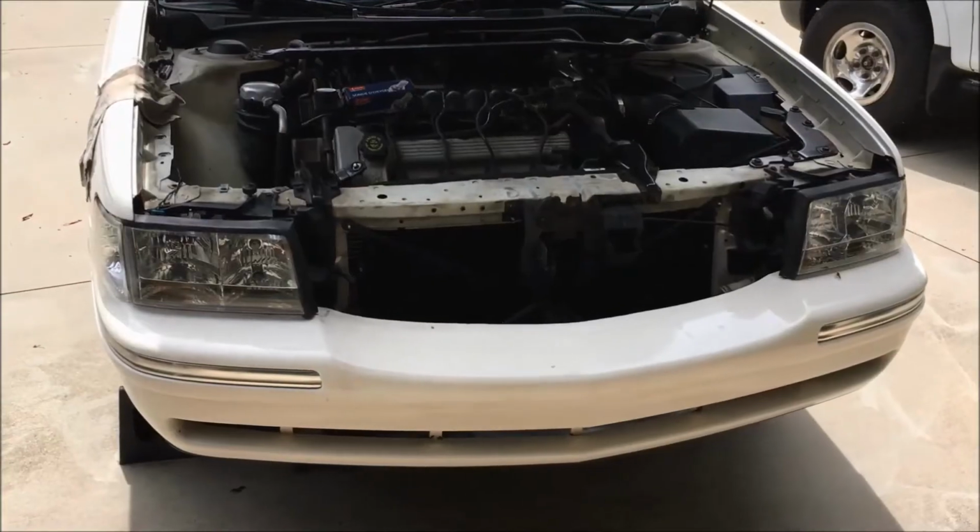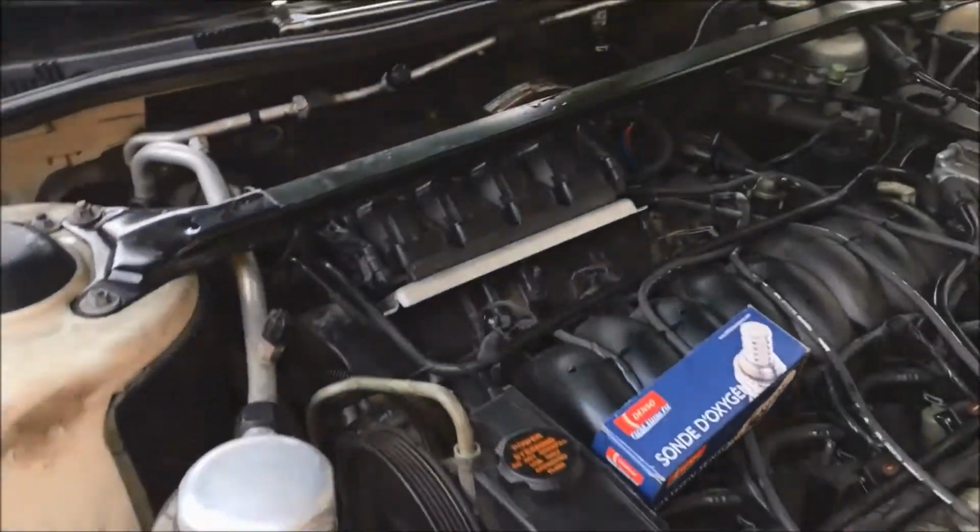The other thing is, you've seen these types of hose clamps. You have to compress this side of it. They're extremely stiff. The ones that you screw are much easier to work with. This is very difficult. In several places during this operation, where I'll talk about cooling hoses that need to be released, and also during a radiator replacement on this vehicle, you need a proper tool to remove these hose clamps. That's why I've got a hose clamp pliers set. It gives you remote access through this piece to use a plier action to compress that hose clamp and get it off.